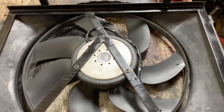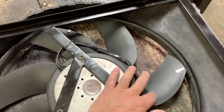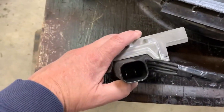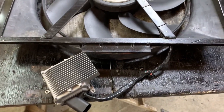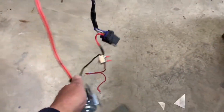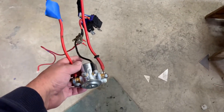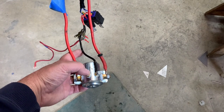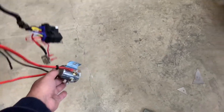The control module I had to secure to the mounting bracket — you must have this. It does run some pretty high amperage wire; I've got about 8-gauge wire to this and I run it through a relay that is directly off of the alternator stud, because that's where you draw your good high-amperage power. When the car is on, the ignition wire energizes that post and engages the fan.